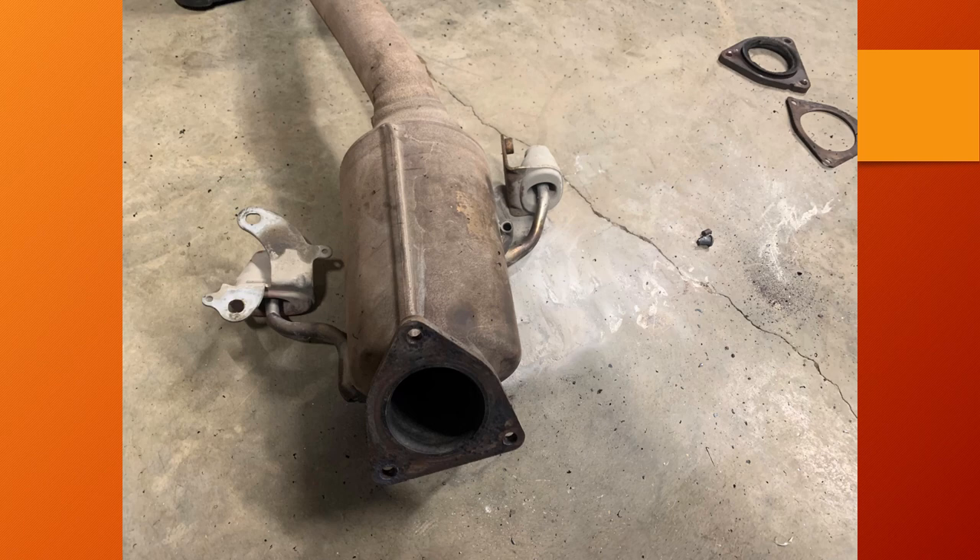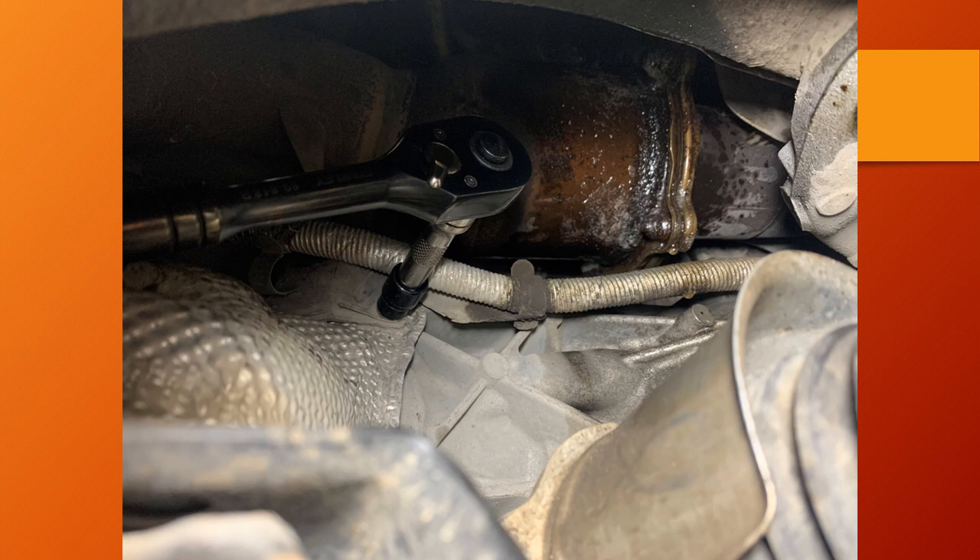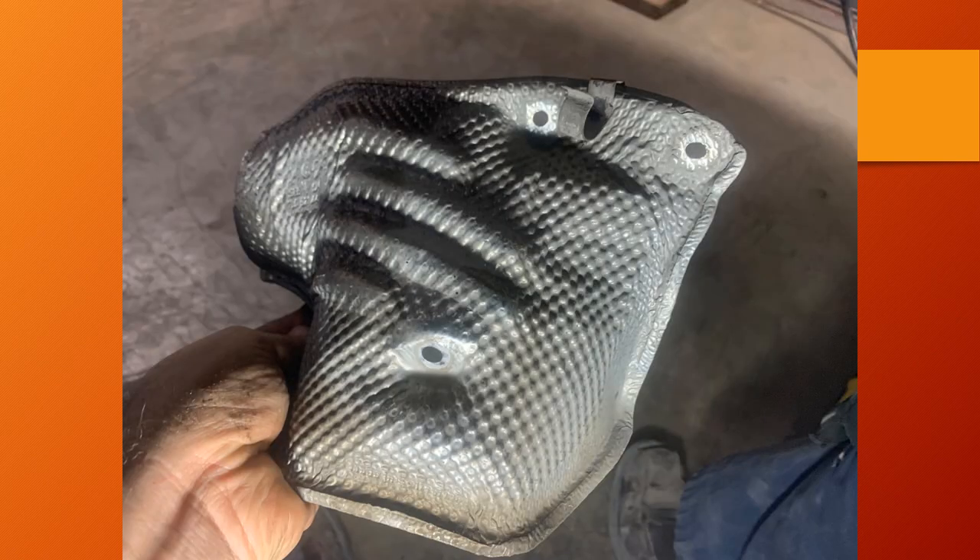That's the main catalytic converter that can be reinstalled once you've replaced the primary catalytic converter. Looking up from the right wheel well behind the right front axle up onto the differential, you can see the primary catalytic converter attached to the exhaust manifold — I've sprayed some penetrant on it to let it soak in for removal. There's a heat shield that needs to be removed on top of the differential — remove the screws and take off that heat shield. It's held on by three 10-millimeter bolts, and there's also a little hook here to hold a wire that just pops off.